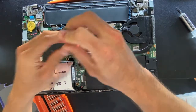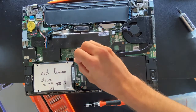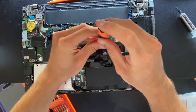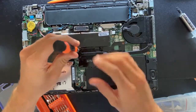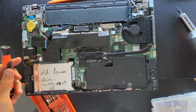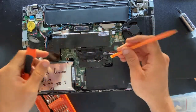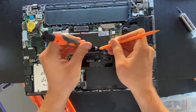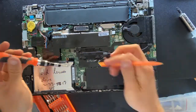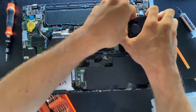After that, there are four Phillips screws to loosen. They are torqued on pretty well from Lenovo, so make sure you've got a good bit that can properly grab those screws. There are retainers on the back of those screws from the factory so they can't fall away. I completely took them all the way out to make sure nothing was holding the CPU cooler as I pulled it away from the motherboard. I used a spudger to help pull the threads up and away from the retainer, then got the screws off and gently lifted up on the fan.